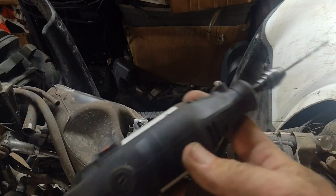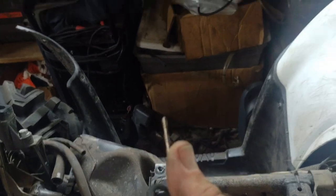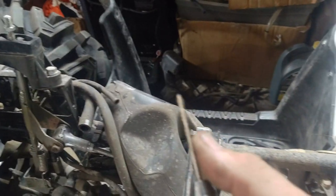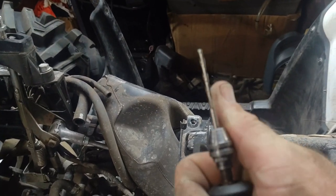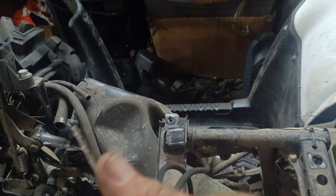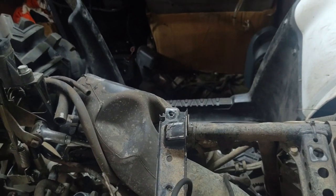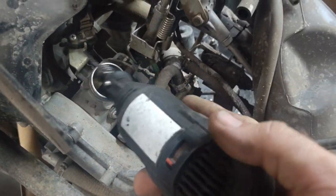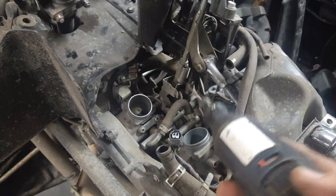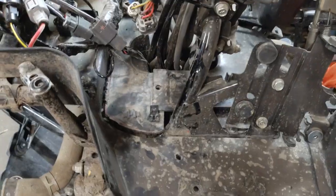They made this little bit for the Dremel - I think it's made to cut drywall with. They used to make a tool called a Roto-Zip and this thing works the same. Crank the RPMs up on this thing and it will chew up plastic and cut right through it. It's not the best for cutting your snorkel holes because it gets a little jagged, but just for cutting plastic like this it works great. I'm going to cover up the throttle bodies to keep any little black plastic shards from getting slung around, and then I'll cut this out.